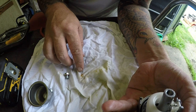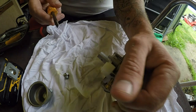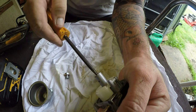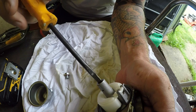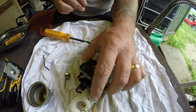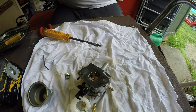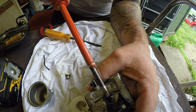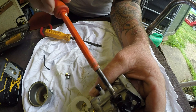It's actually congealed fuel in there. Let's try and get this main jet out - that's the next thing to do, hopefully it'll play ball. It is only two years old, so it should come. Right, now it turns so I know where to put it back - it's currently sat at around about two o'clock. It's well in there. There's a bit of gunk in there, and it actually looks like there's a bit of a seal gone on that.